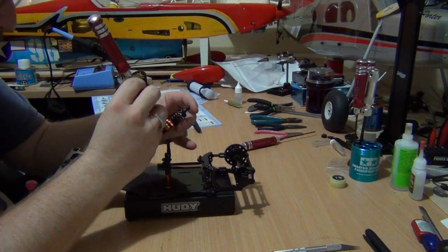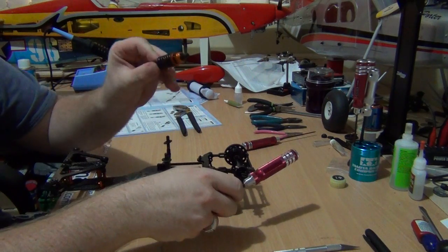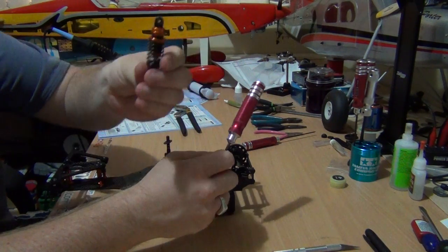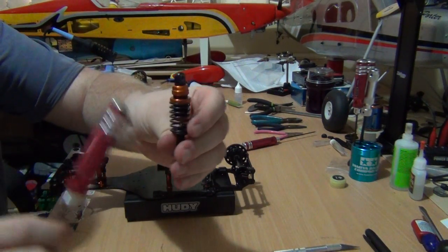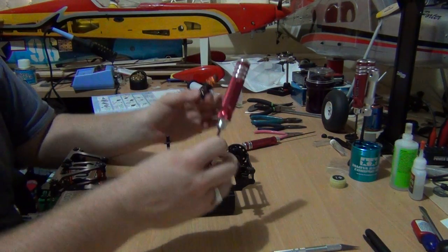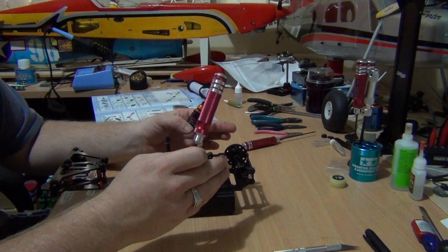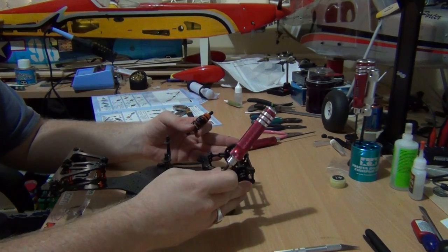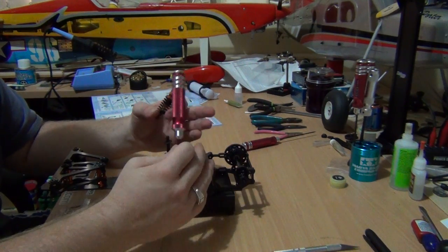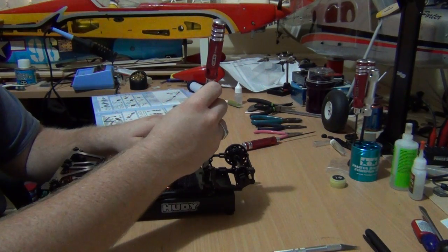Three millimeter driver — or two and a half — no, three millimeters. Now it also says to note the orientation: what would be the top of the shock if it was upright on a touring car is to face backwards. The main reason for that is you want optimum weight distribution — on a two-wheel drive car you kind of want a lot of weight at the back.